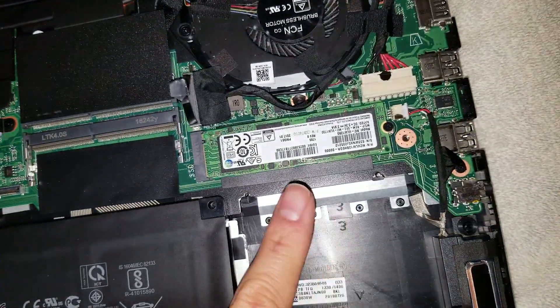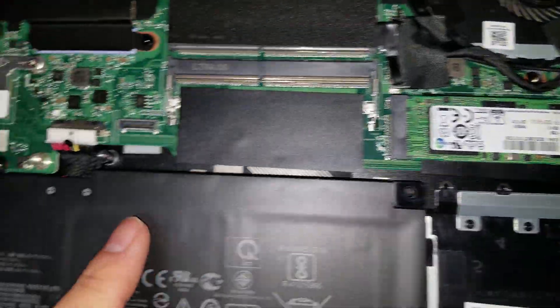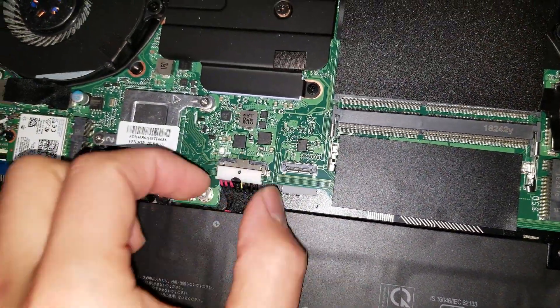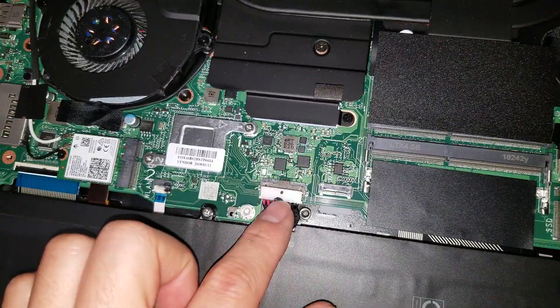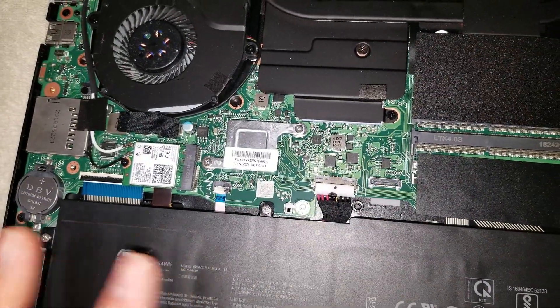You can see if you wanted to change the SSD or the hard drive. Usually what I'll do is always disconnect the battery first — I've already done that. You basically grab the two edges, pull it, wiggle it sideways, and disconnect it. Then hold the power button to drain any remaining power so you don't damage anything.